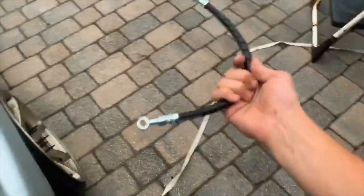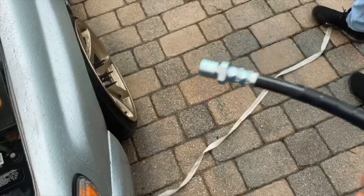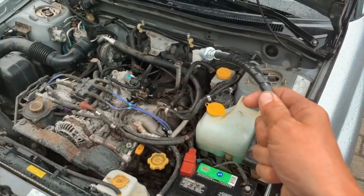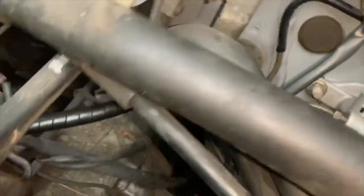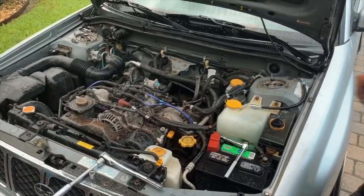We're back. This is the piece we needed - it goes into the slave cylinder and connects to the hard lines that go to the clutch master cylinder. We just need to take off the fitting down there. The line is already a bit loose right here - just going to take that apart real quick and replace it, then bleed it. Should be all good after that.